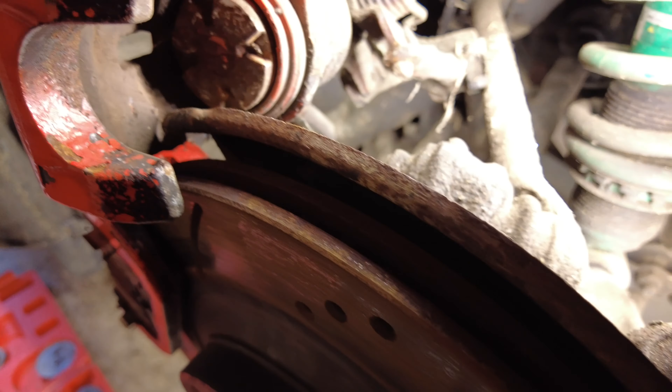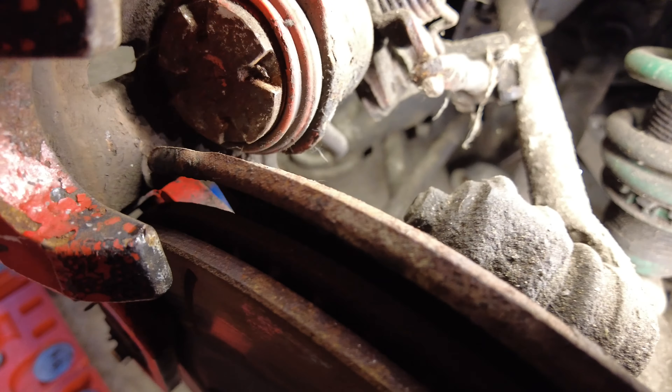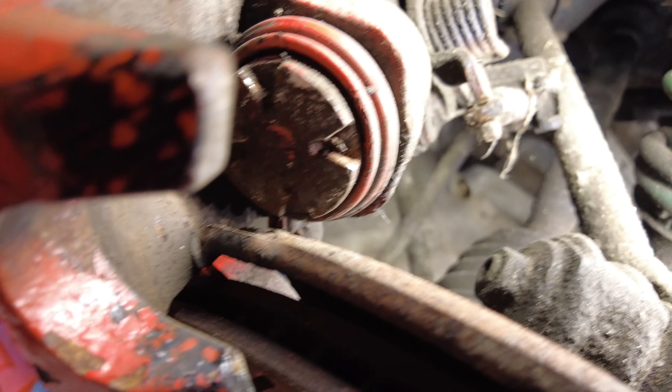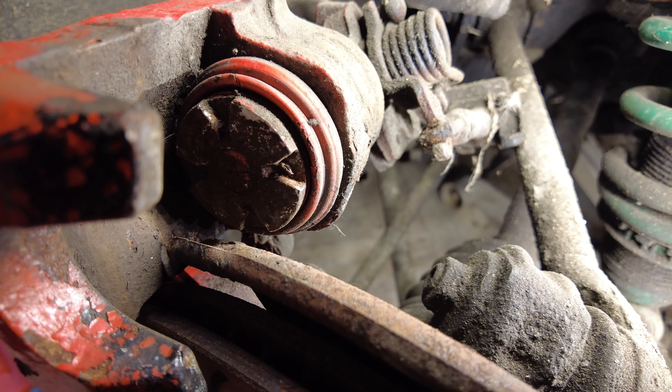While you're twisting these pistons, you want to spray something to lubricate between here and the boot — sort of in between the boot and the piston — and that will just help so it doesn't tear the boot, because that can be an issue. I'm going to use something which you probably shouldn't do so I'm not going to recommend it, but a bit of googling will tell you what you need.